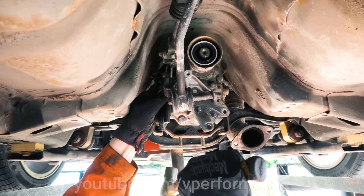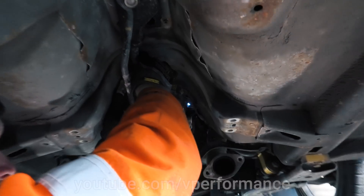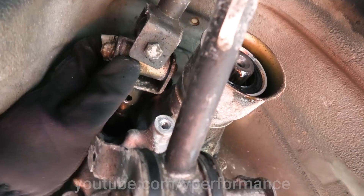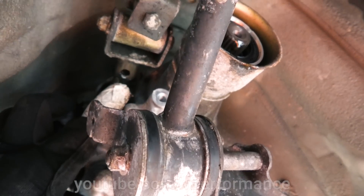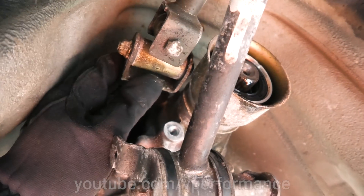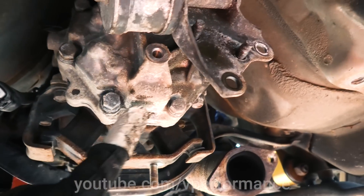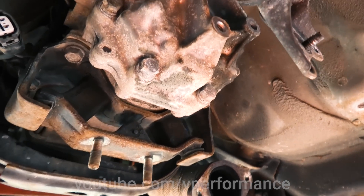It's moving — two springy roll pins. Does that slide out of the way enough? It does — she's totally off. This doohicker here is attached to your gear lever. It's got two springy roll pins that I just hammered out. Once you've hammered them out, it just wiggles back out of the way. Then all we've got to do is undo all the bolts around the perimeter, pop that end off, get drowned in smelly gearbox oil, and we're good to go.